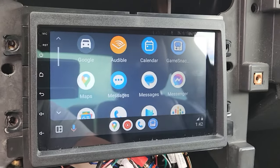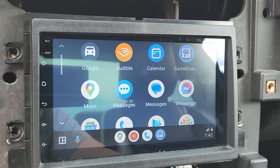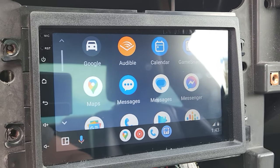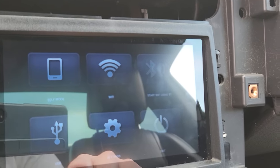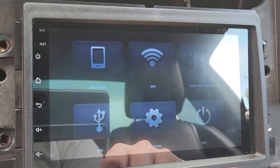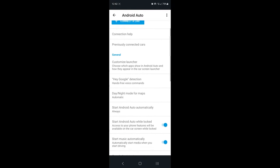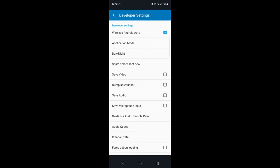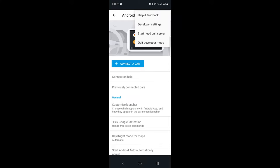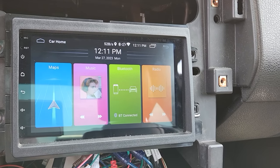If you connect your Android head unit to your phone's hotspot, you should be able to connect wirelessly to Android Auto via the Wi-Fi button. You can see that I am not connected to my USB cable but I'm still able to interact with Android Auto. If you have issues connecting wirelessly and it keeps resetting itself in Head Unit Reloaded, open up your Android phone, go into the Android Auto settings, and look for the option to enable wireless Android Auto. That's buried under developer settings, but sometimes it's also available at the bottom of the Android Auto settings. If you're still having issues, click the button that says 'Start Head Unit Server' and that should fix your problem.